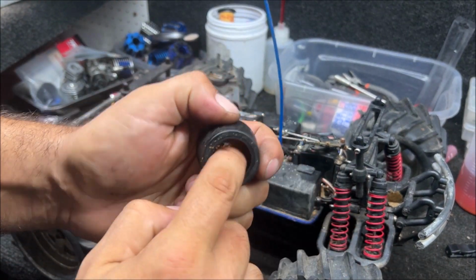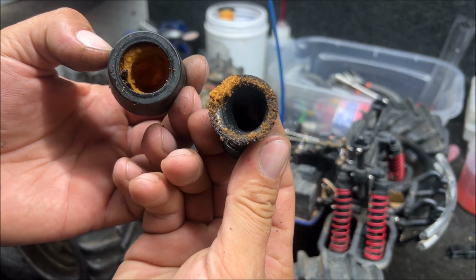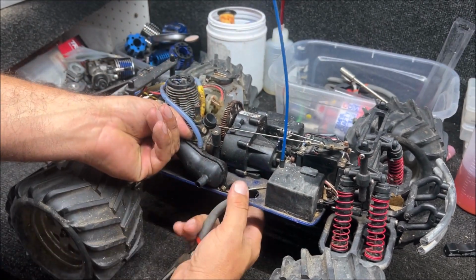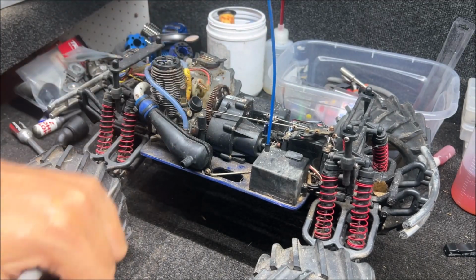Like if it's your first time, that's garbage. Okay, you have to knock all that out. Go wash this with Dawn soap and get all that crap out of there. So here's another locked engine. Try to spin the flywheel with your finger. If you cannot do that, be patient. Do not try to use tools in there to turn the flywheel.